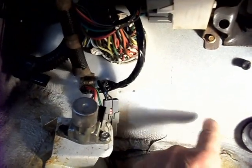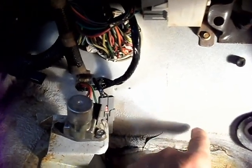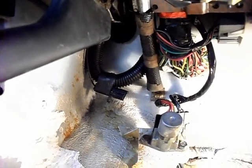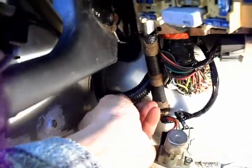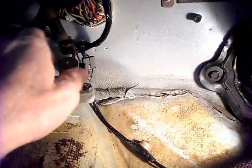What I'm going to do is mount this in on a slight angle, then make a hole and have a rubber hose coming out through the firewall and dripping onto the ground on the outside — instead of dripping on the floor. It'll be about three-eighths to a half inch in diameter rubber hose, like gas line. This lip here will go up underneath, and the whole thing will get siliconed on these two sides. The tray will be 11 inches up, which will cover any future leaks that might develop up in there.